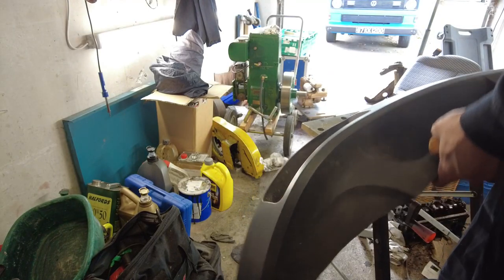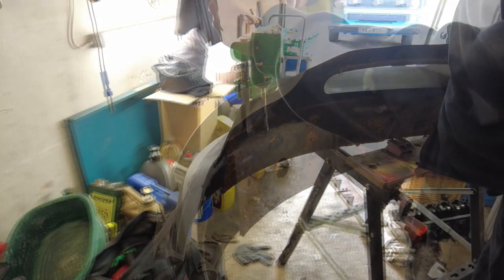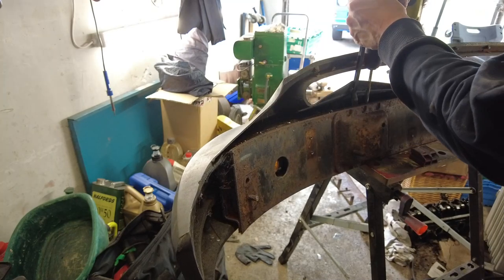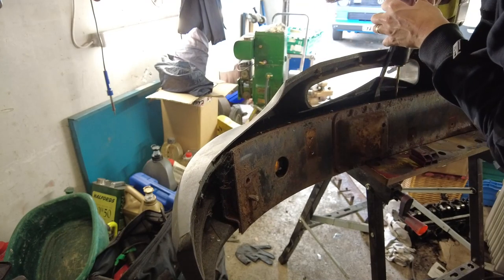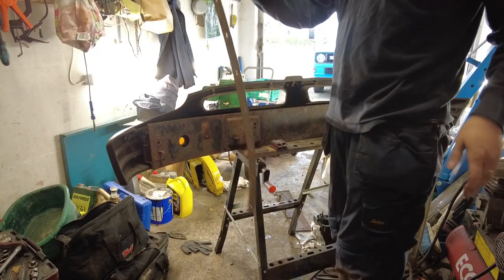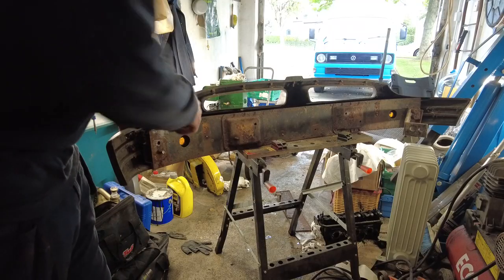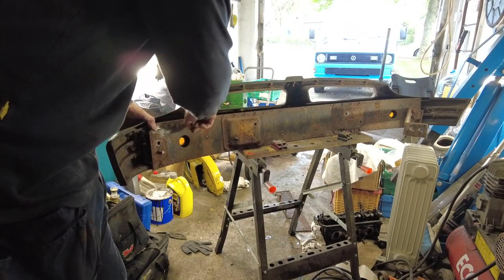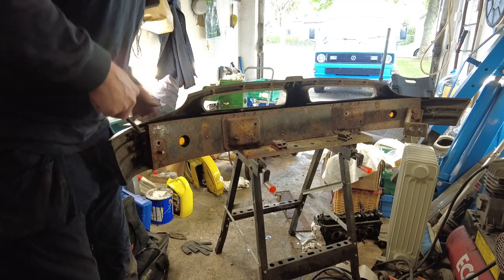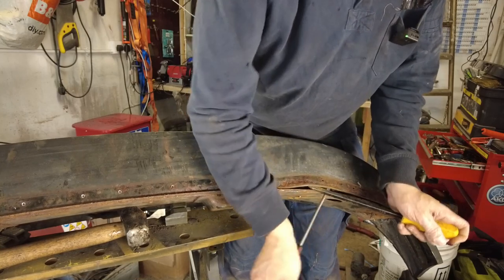It's really going to be just a case of actually bending the rubber back to try and get in at the rivet heads. It's a bit more difficult, but what you need to do is just make sure you don't damage the bumper with the drill bit, so you get that pry bar in there and keep it away from the drill. That's the two strips off that hold the bumper in place now — the steel part. The strips are off but the problem we still have is the shanks of the rivets are still sticking through.